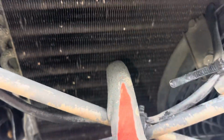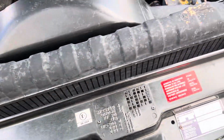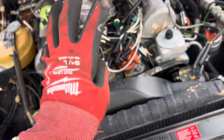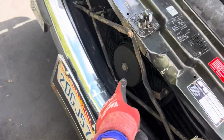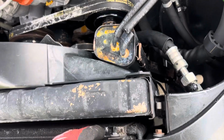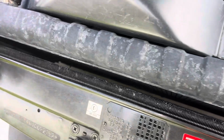Larger tube and fin. So this is the 3/8. Now this is about 14 fins per inch. This is a tighter fin grouping than that old Bentley in there. In mild climates, these do very well with a 134 retrofit from 12 to 134, as long as you have a good new thermal fan clutch on them and a good fan. You could go the extra mile and make up some styrofoam or plastic sheathing, and cover all these gaps here.